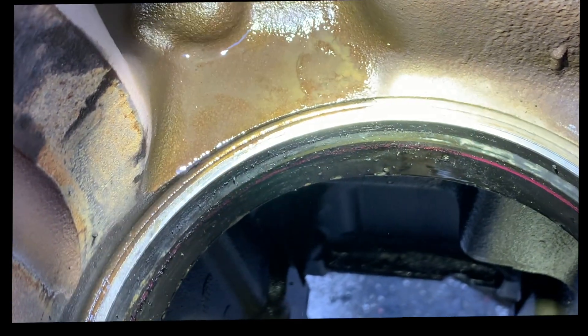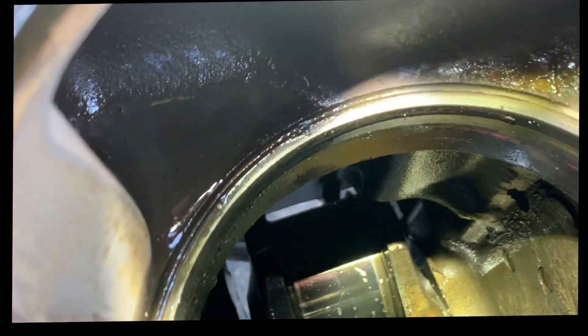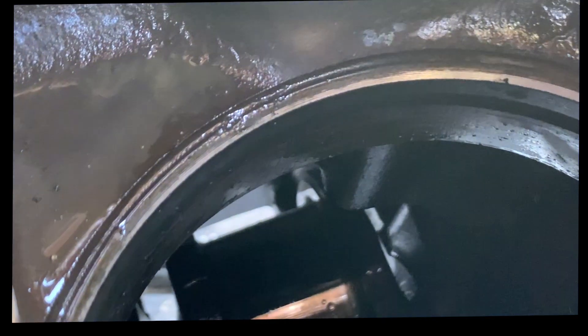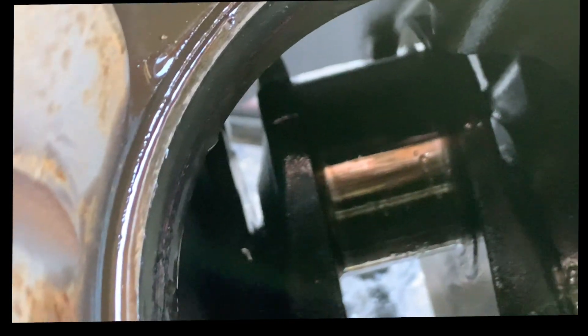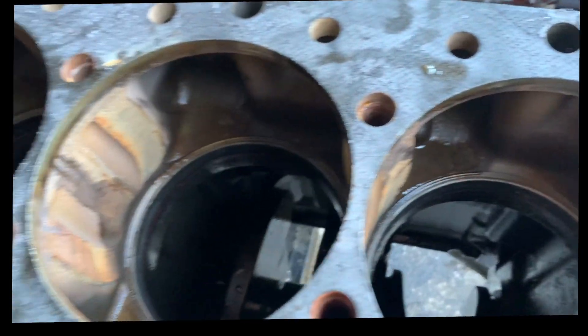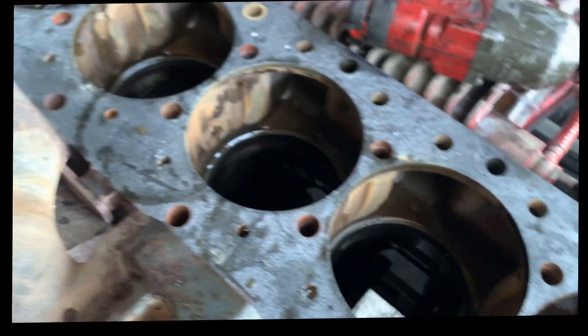If we look around all the edges, we had it on multiple liners. This is pretty much where you have to cut it to get it even again, and then you put a shim underneath the liner to get it to the correct level, correct height, and then you put everything back in. So we're looking at the edges here — not the inside of the block, but the edge on top.